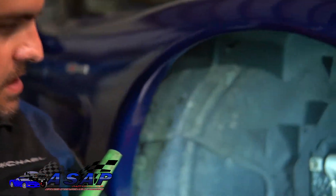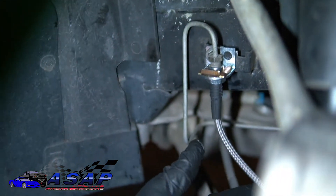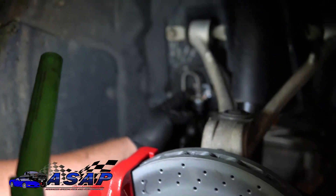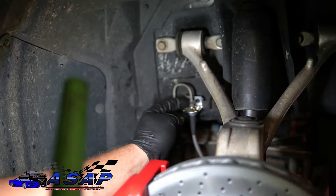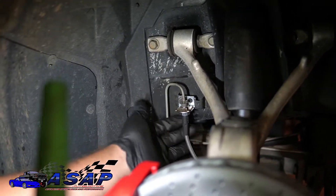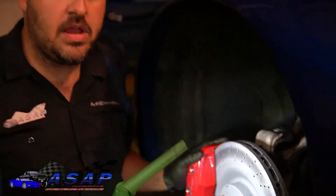For the front line routing, make sure your line isn't twisted — route it out of the way of where the wheel is going to be. You've got your bracket with the 10 millimeter tightened down, your 13 millimeter, and your 17 millimeter down below. Snug that down, make sure it's routed correctly, and now we can go through and bleed the brakes.